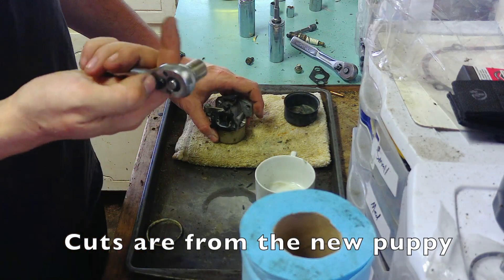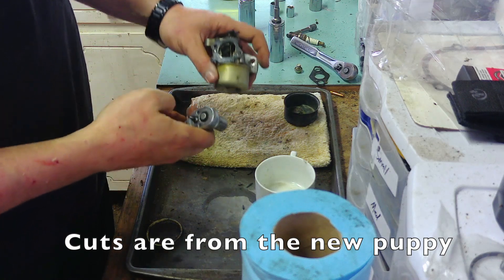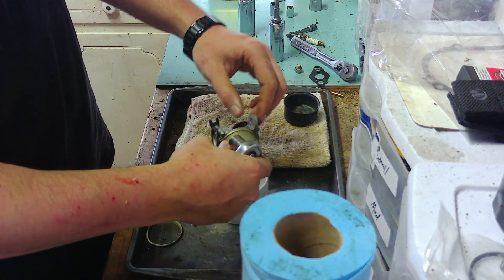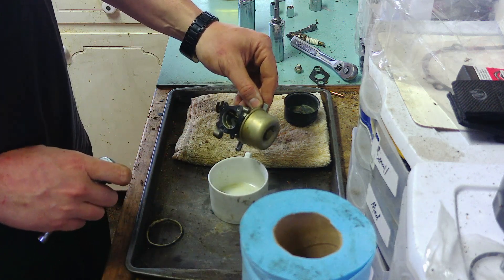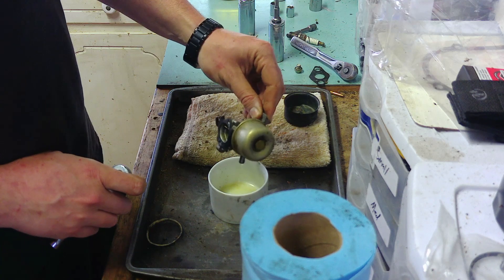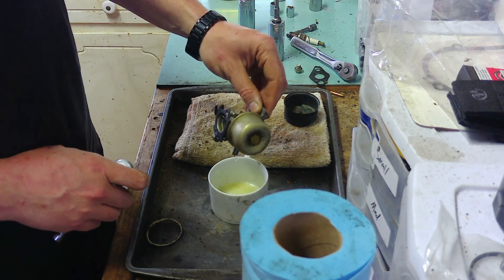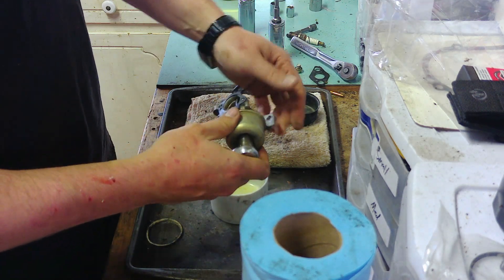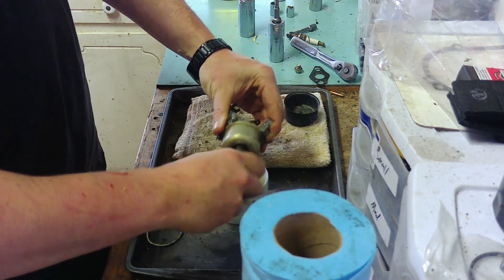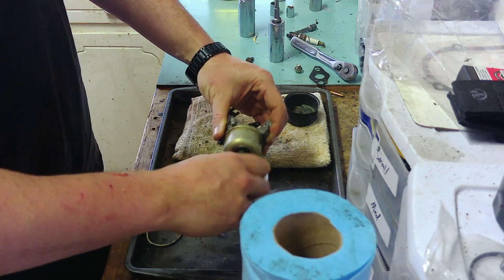We have our white cup and half-inch socket. Let's drain a little gas out of it. If you tip it towards the fuel inlet it'll drip off a little bit. Oh, I see water already. Well, I think we know why it probably wasn't working.